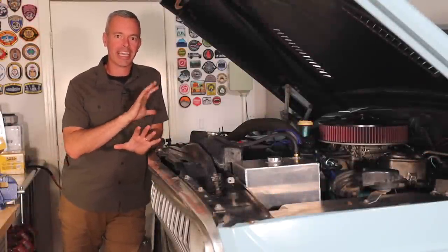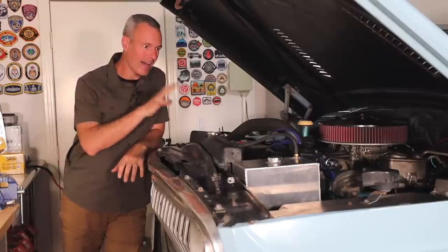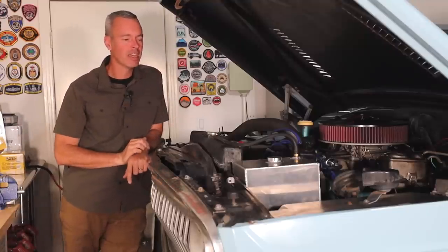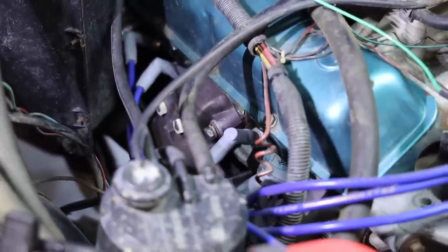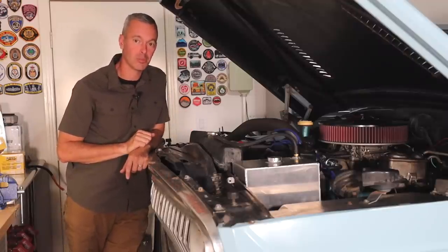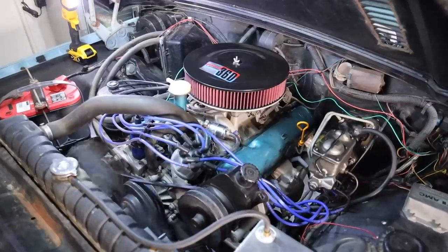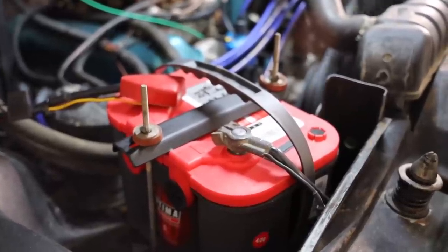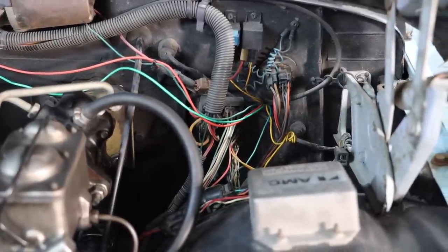Let me talk about the mechanical and electrical gremlins I've encountered. When I drove it home 150 miles, it ran rough and was loud because of an exhaust manifold leak — we replaced that. It then ran really rough because one spark plug wire wasn't seated all the way, which took a while to figure out. It's had a complete tune-up: new plugs, wires, cap, air filter, fuel filter, and a new battery. I've also chased a lot of dead-end wires and started to clean things up, but there's still a lot of electrical work to do.